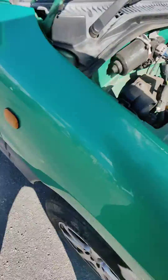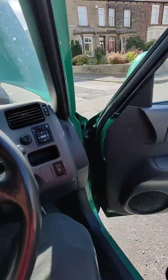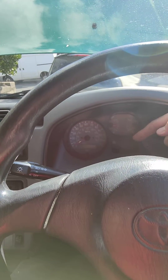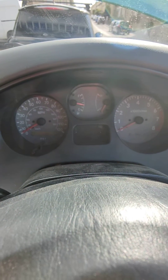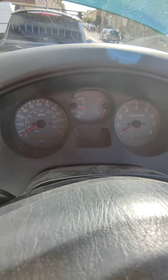Once you've bridged that, get in the car. What we're going to do is turn the ignition on and count the flashes of the ABS signal light. I've already done this before I made this video so I know what it's going to do, so hopefully it'll repeat it.